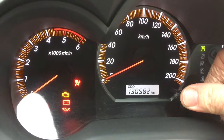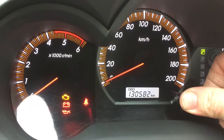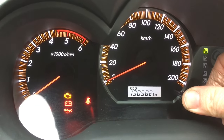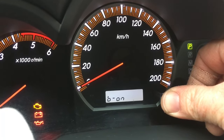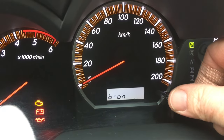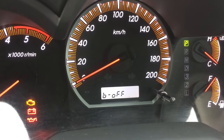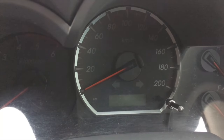We hold this button — we need to hold it for at least 10 seconds, so you can count to around about 10. I need to use my other hand to plug in my seatbelt, so I'll just quickly put this down for a second. I'm going to click the seatbelt in and then show you on the dash. It's going to show beep on, beep off. At no time have I released that trip meter button. You can toggle between on and off as much as you like, and you turn on and off the same way. Now we're in off position, so we switch off everything and it'll be in off position — no more annoying seatbelt beep.